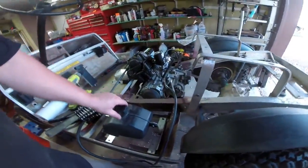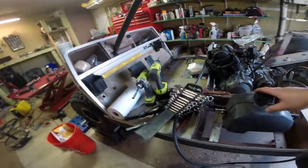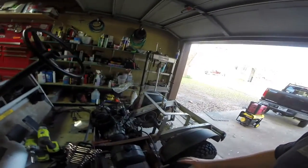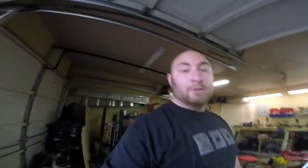We got our little gas tank mounted in here and it's pretty solid — you want a little bit of flex but mostly solid. Some of you may ask: the spigot's down here but the carburetor's up here, how does a gravity-fed tank work? Well, I ordered a little tiny Bosch fuel pump that uses intake vacuum to run, and it'll pump gas from down there up to the carb. This fuel cell is about a gallon, so range will be somewhat limited for now, but I don't want to spend a couple hundred bucks on a big aluminum five-gallon cell yet — this will be more than enough to get us going.